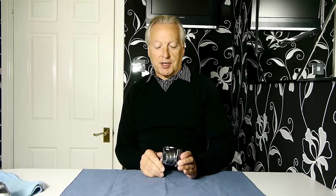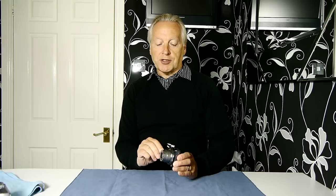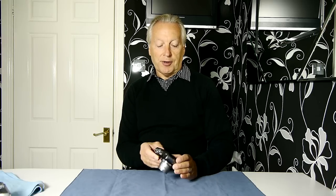Hi, this is Graham. Hope everyone's having a great day. In today's video I'd like to show you how to clean the sensor in a Panasonic Lumix compact camera. The sensor gets full of dust or pollen due to the fact that when the camera extends in its initialization mode, the action of the lens moving out causes air to be sucked in through any aperture in the camera, maybe through the back, the screen, or in fact around the lens itself.